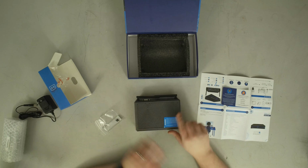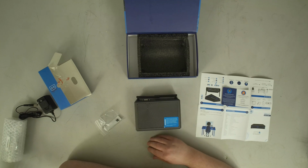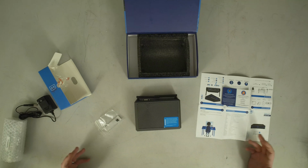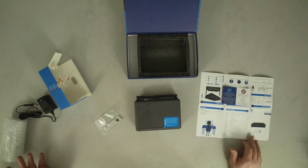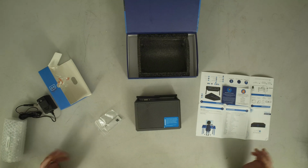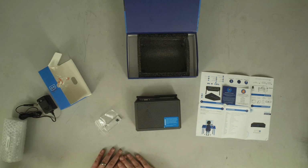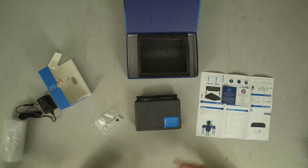There's a little warning label on here that says it uses an Intel processor featuring Intel Burst technology, which is a weird way of phrasing it, but it said the speed and power consumption of the device will vary depending on its use. EIST, Intel Enhanced SpeedStep, has been around since Pentium 3, I think, maybe the Pentium 2. And then Turbo Boost has been around since at least the early Core 2, or the late Core 2 chips, I should say, could boost up 1 bin, and then later chips started to introduce increased turbo profiles.